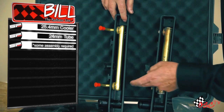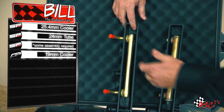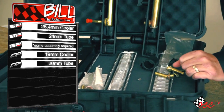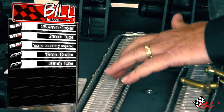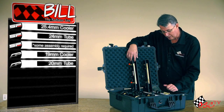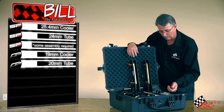On the AP unit you're going to notice the first thing is it's got a 19 millimeter concentric cooler inside there — not a 25.4, but 19 millimeter — and it has a 20 millimeter tube, not a 24 millimeter tube. It also has a B tube where you can see in the center of the tube it has a construction to support it, because this tube is thinner than your standard wall tube. So we went from a 24 to a 20 millimeter tube, and a 25.4 to a 19 millimeter cooler.